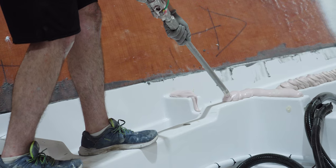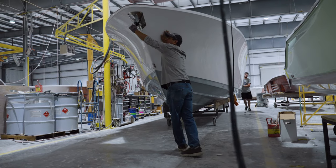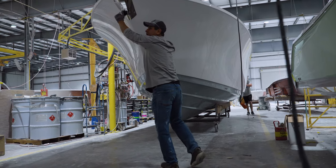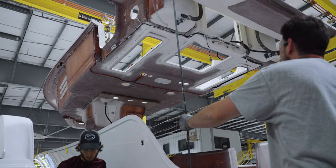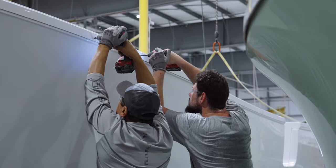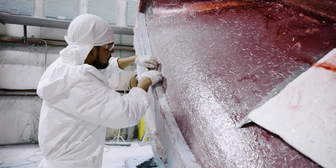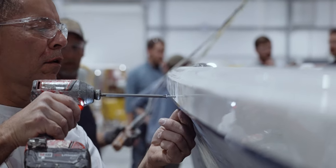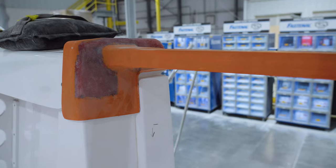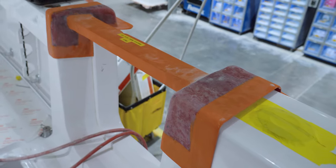The team carefully traces every mating surface and works toward the transom, working swiftly and accurately as many tasks must be performed simultaneously. During the final pinning process, the deck is lowered almost all the way, leaving just enough room to complete the necessary hose connections. Work then begins pinning the deck and hull, starting at the bow and working toward the stern — extra composite materials were applied in this area during lamination to ensure screw retention at the pinning flange. For boats with side entry doors, special clamps guarantee adhesion all the way around and are removed once cured.